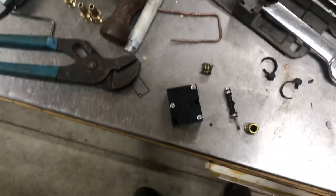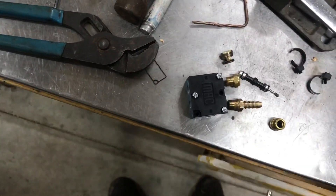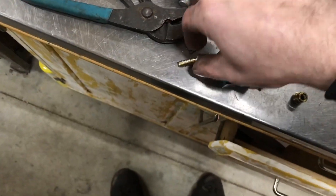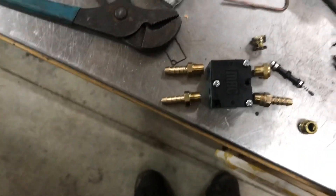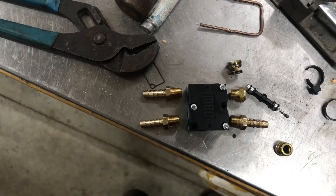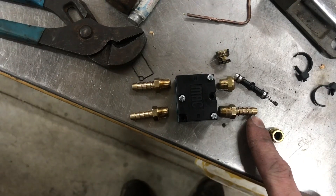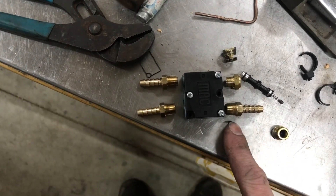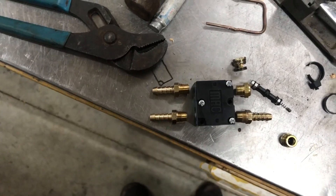I have torn this thing down. As you saw before, you had your vent up top here, your N on this side, then you had the top of the wastegate and the bottom of the wastegate. What I was having was, when I was doing a boost leak test, I could hear the wastegate opening. Air was coming in to the boost control solenoid and going out to the bottom of the wastegate, causing it to crack open.